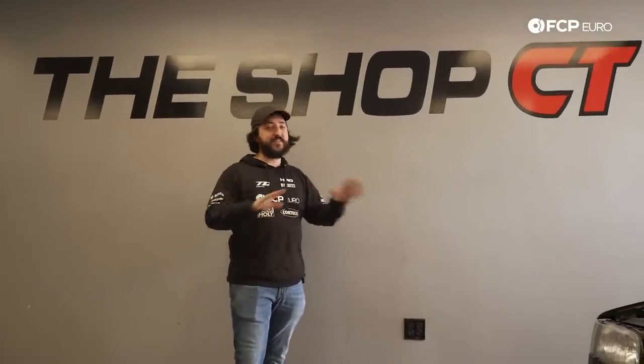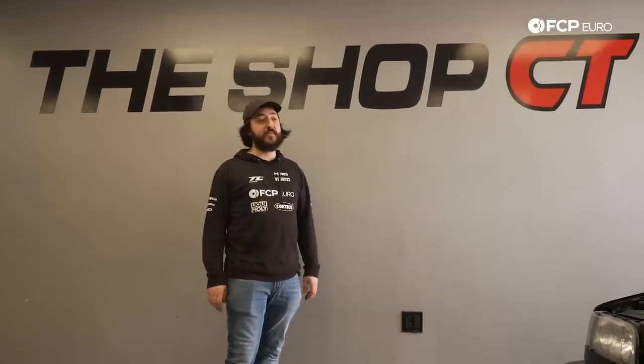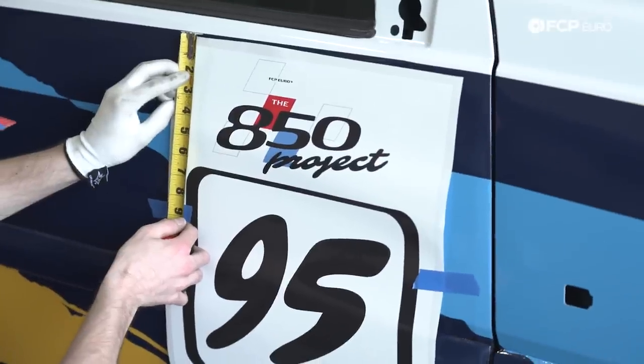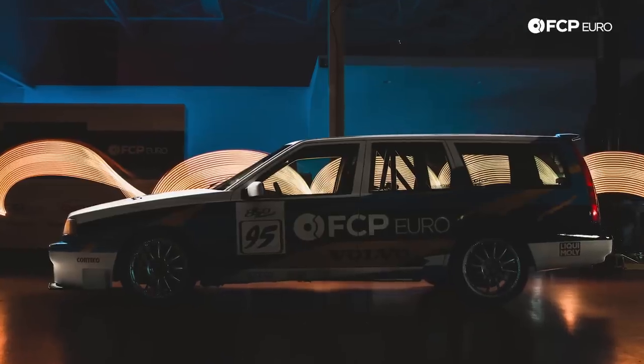The stressful time is over. Kareem fine-tuned this thing, the power curve is super smooth — we made 175 at the wheels, which is probably over 200 at the engine, and that's a 25% increase in power from the 140 wheel horsepower our original engine dyno'd here years ago. We adjusted the fuel table, timing table, and VVT table and got a lot of power and torque under the curve. It's basically making close to what a stock turbo engine would make, but naturally aspirated. It's time to throw the livery on, get the bumper on, and get this thing looking as good as it sounds. Like, comment, subscribe — next episode this thing will actually look as good as it sounds.